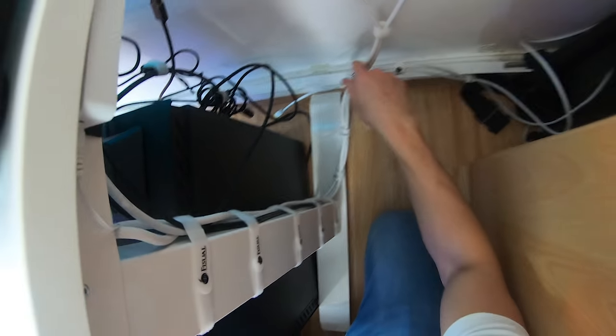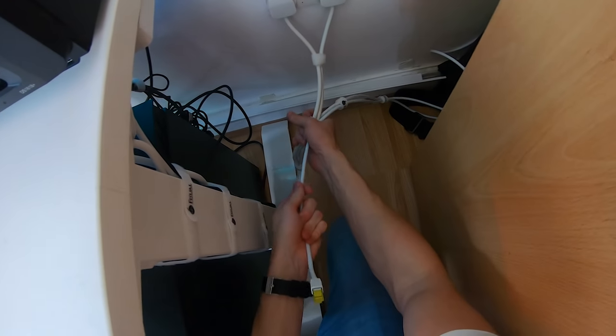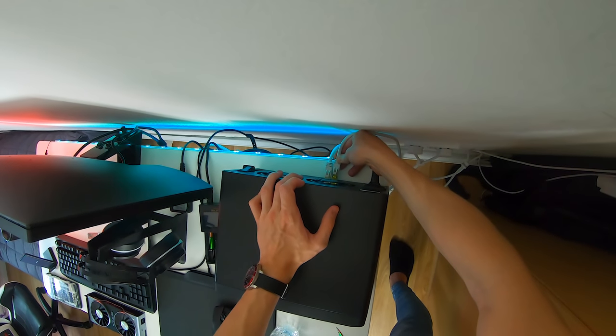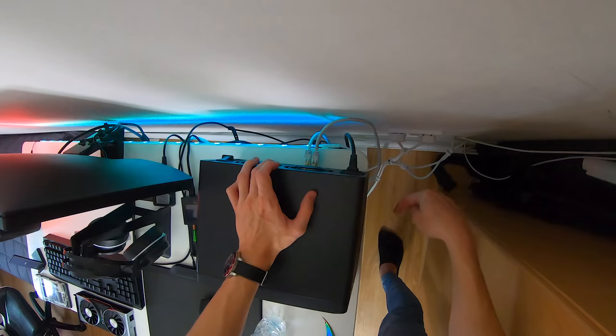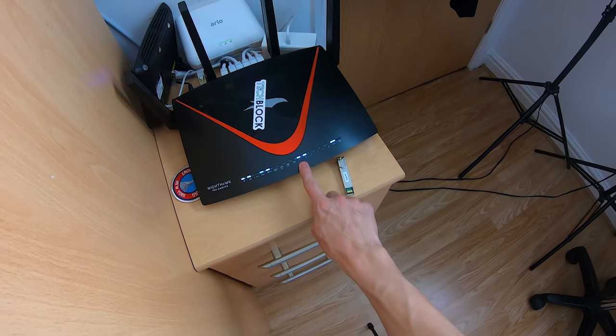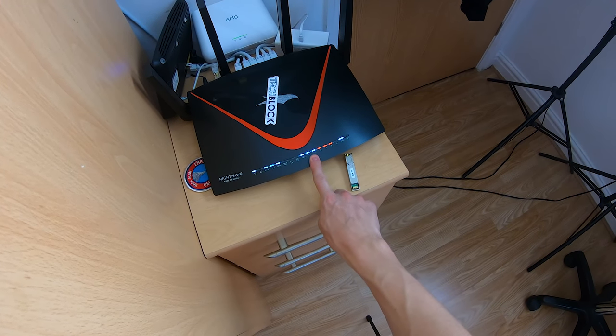In our current situation, the most we could achieve in terms of transfer speed is between two and four gigabits per second between my Synology NAS and my PC, which should be quite the improvement. I'm going to salvage the Ethernet cable from this secondary PC and plug it into the Synology NAS instead. I yank on the cable to get enough length, and now we have two Ethernet ports plugged into the NAS. We can see LAN 2 and LAN 3 flashing away — I believe those are port one and two on the router, which should support link aggregation.